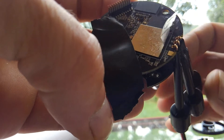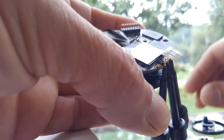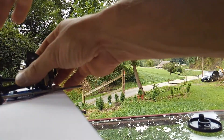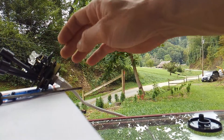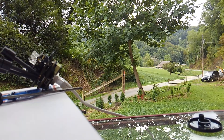Transmit goes to receive and receive to transmit. You'll need to solder those on, or use little clips like I did. At this point, plug the device back up — first hook up your PoE power to the device, then plug the USB into your laptop.